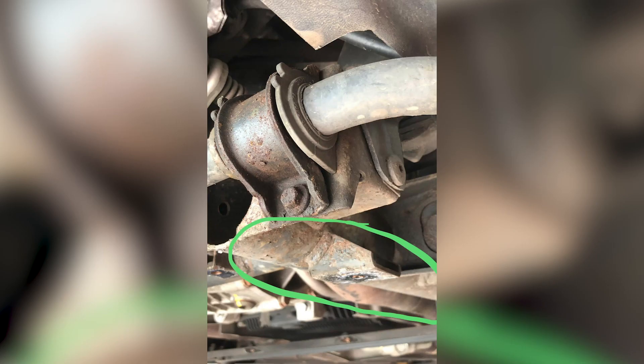If we have a look at a typical subframe - I've circled the section in green - we can see what normal corrosion looks like. This is just surface corrosion which, if you got a wire brush on it, would remove and you'd be left with very healthy, almost perfect bare metal. None of the wishbone arm suspension mounting point brackets are compromised or weakened, and it wouldn't be failing MOT.